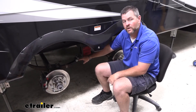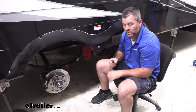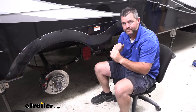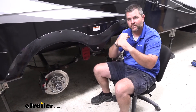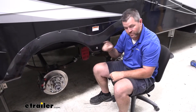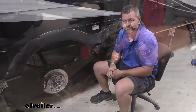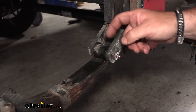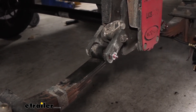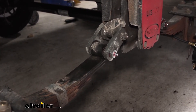I suggest going up to a wet bolt if you don't have them, and go to a bronze bushing. When you put the bronze bushing in and run the metal bolt through, it allows you to grease that fitting. When you're able to grease it, it cuts down the friction between the two metal pieces. Putting fresh grease in pushes the old stuff out and keeps it fresh — it's going to last a lot longer. With wet bolts and bronze bushings, your suspension components are going to last a lot longer than with a dry bolt and nylon bushings.